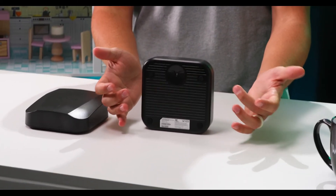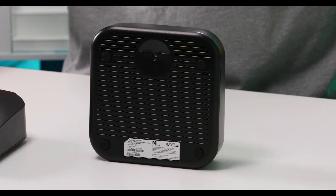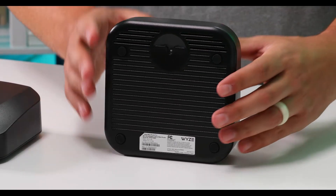About flat surfaces — you want to make sure it's not placed on a soft surface. Each mesh router emits a little bit of heat near the bottom because it's an active electronic device. If you put it on a soft surface, that surface will absorb some of that heat and impact performance, potentially overheating your router. You also wouldn't want to put it near something emitting heat or in direct sunlight.